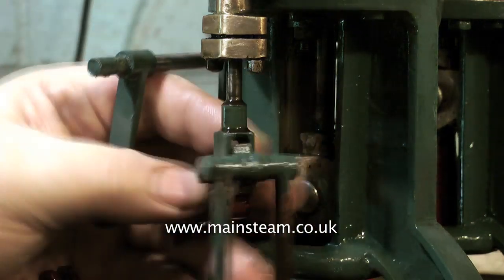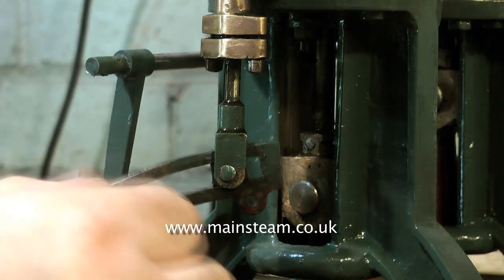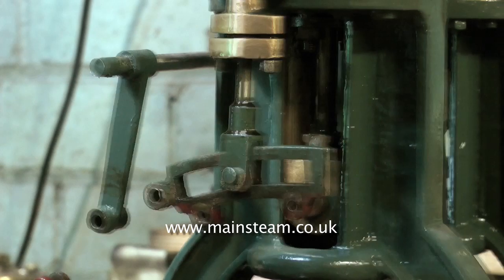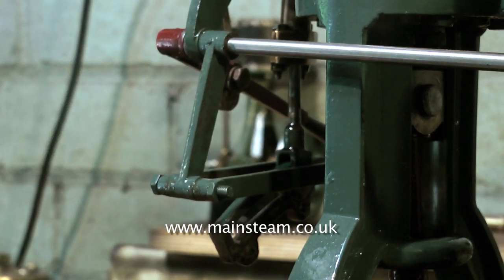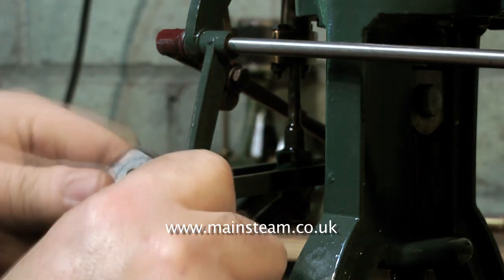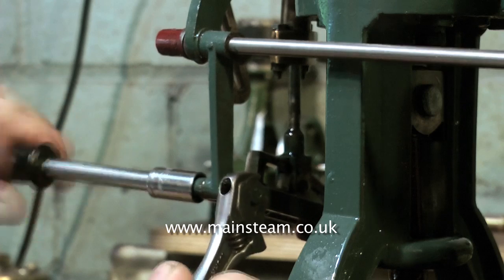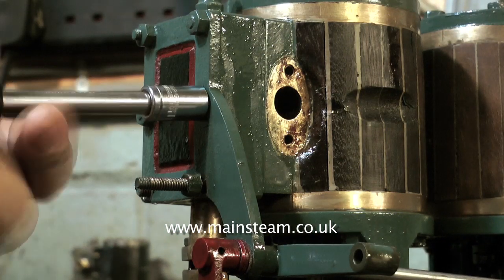It's now time to completely take off the valve gear. The valve gear has all been painted, which is really a bad thing to do — it never looks right; valve gear should be metal-coloured in my opinion. Looking at the state of this engine, I would think the valve gear has been painted for a couple of reasons: one being the metalwork is probably rough, and the other is it's probably rusty as well. I will find out in due course when I remove the paint.